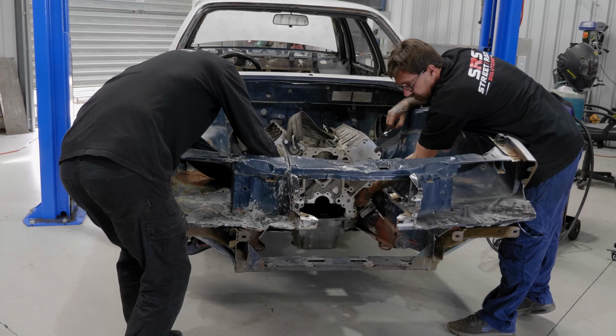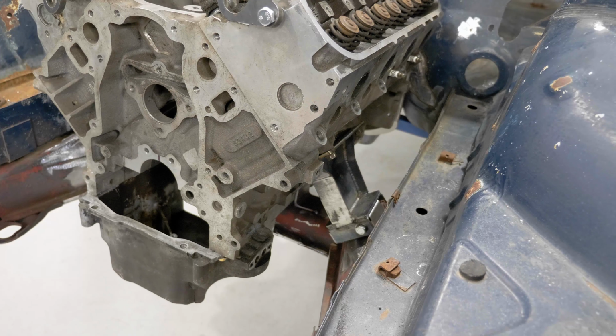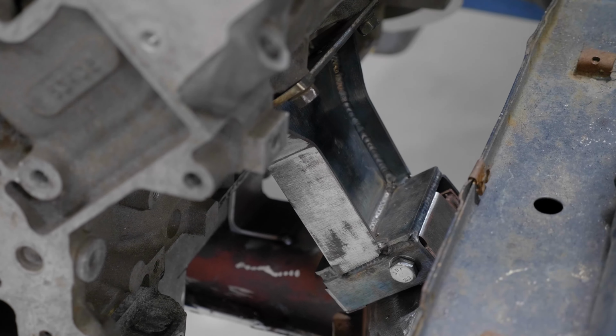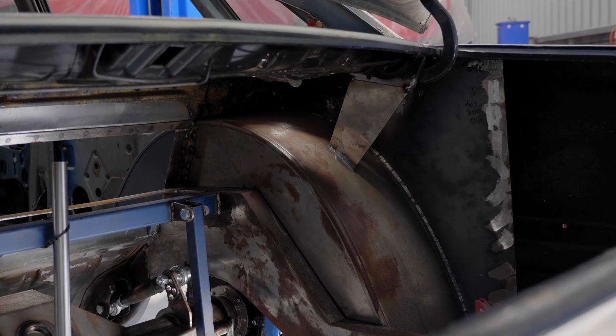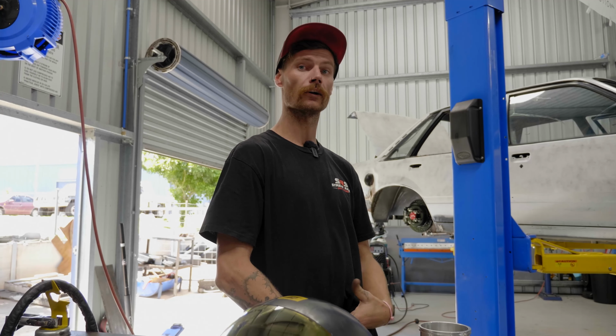We got the engine mounts done up for it, so it's all mounted in position. The LS, they're pretty hectic, eh? They're quite one-off, very unique engine mounts, I would say, George, and everyone watching. Did a little bit in the VL, George, in the boot, and everyone watching. So we had to cut the supports from where the boot hinges latch down to the wheel arch because we tubbed it. We had to make the new supports for the boot hinges to swing off, so I just tacked them in the car.